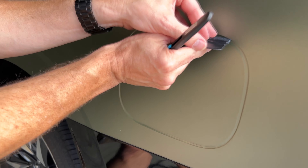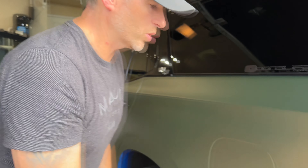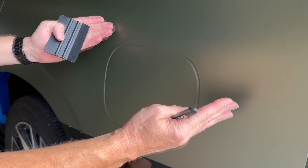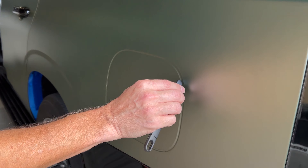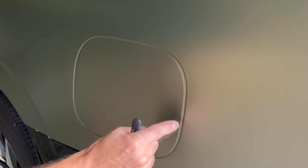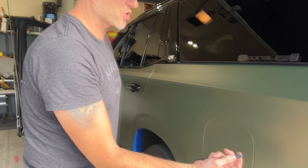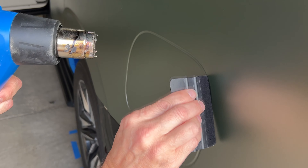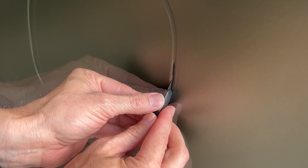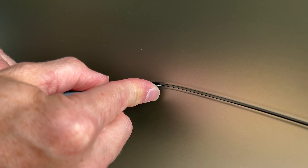I'm going to demonstrate cutting with Vivid's precision gliding knife. The blade is positioned right in the middle because it's designed to cut in between gaps. To cut out for this door I'm going to lay the blade right in the middle and drag it all the way around. Before I do that I'm going to heat this up and sink the crevice in a little deeper. On a black vehicle this works well cutting in the middle. If the vehicle had a lighter body color, I would remove the cap altogether to get more film inside, cut up against the cap to give extra material to fold in, then wrap the cap separately. But for this demonstration I'll show you we can get away with cutting right in the middle.